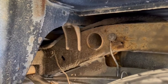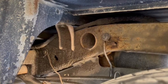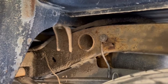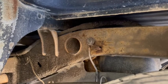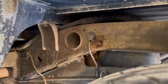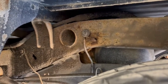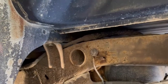Monday morning I need to call and see if anybody's got a fuel pump in stock. On my old truck I had the same problem and had to replace the pump. There are three ways to do it: you can drop the gas tank out, which is a real pain, or you can cut a hole in your truck body — then you always have a hole to look at — or you take the body off.